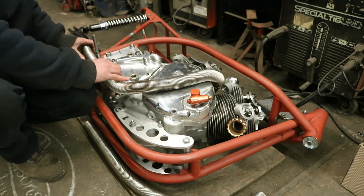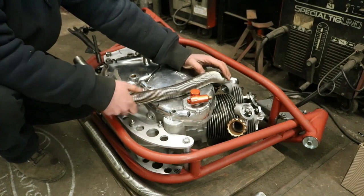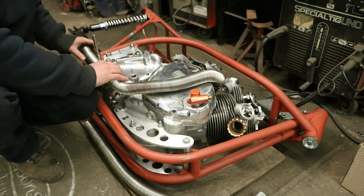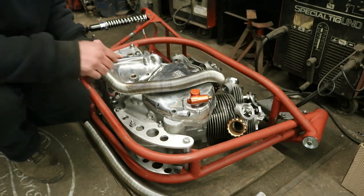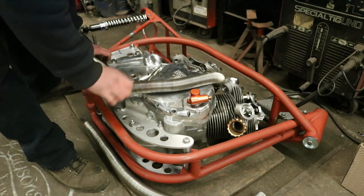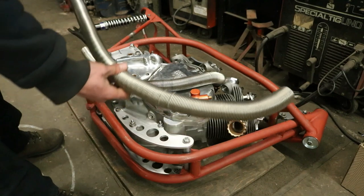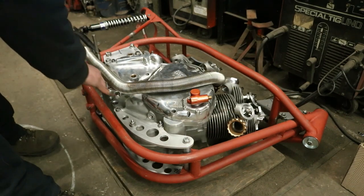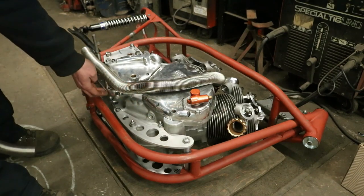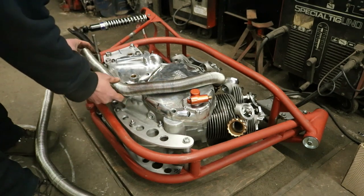Just getting that right underneath that peg - that little bend I've just put at the back fits really well on here. I've slackened that bend out a load now because I want it to follow that frame for as long as possible. There's a bit of a gap behind it so I might actually just be able to skim it along, but then there's this bit where the gearbox sticks out, so maybe drop that one down a little bit. Yeah, that's worked a bit better.